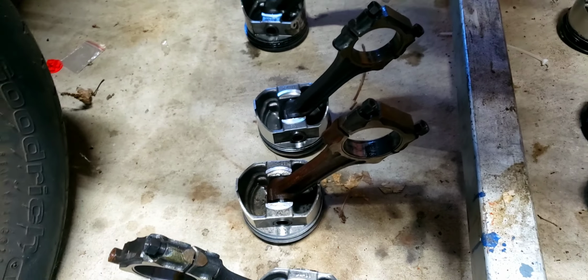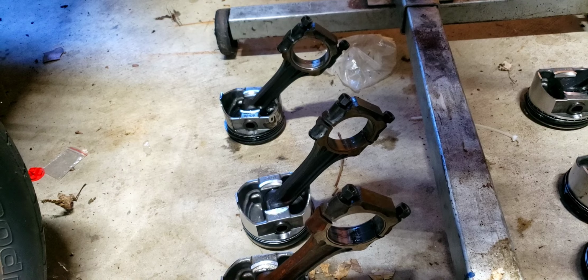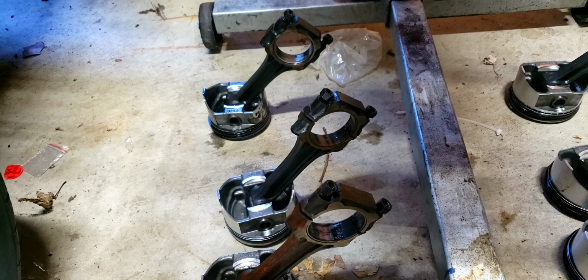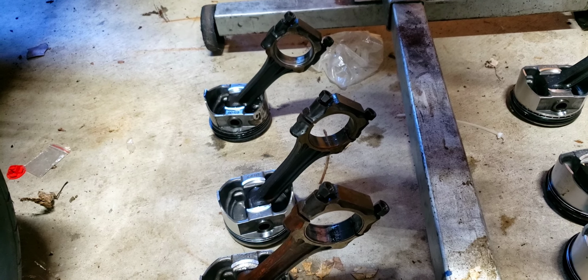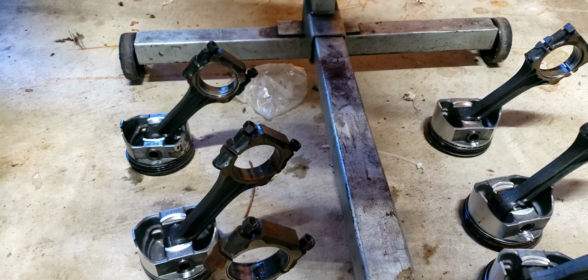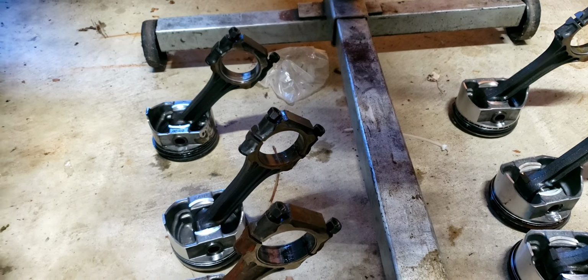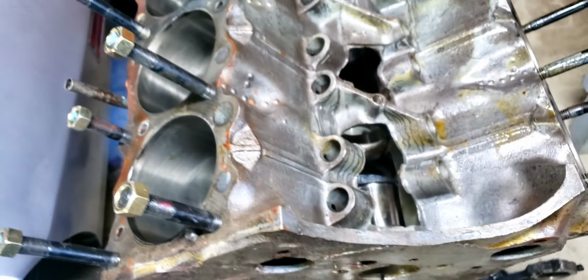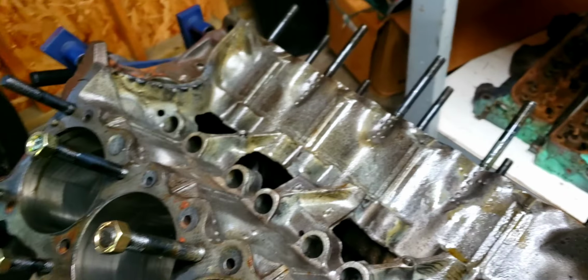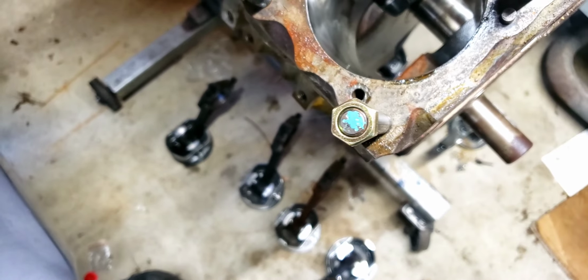Now, because I'm going to be keeping the turbocharger, it's going to be an aftermarket turbo, but you get my gist. These piston rings have to be regapped, so when this motor builds excess heat, the ring gaps do not meet and collide with each other, causing failure. So I pulled all the pistons out and will be installing new rings.